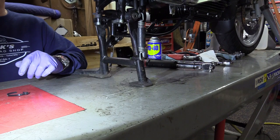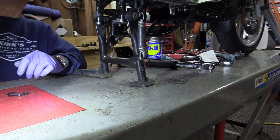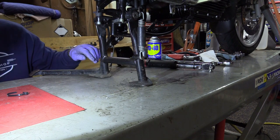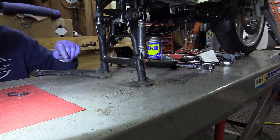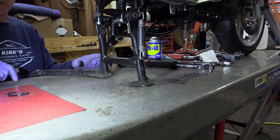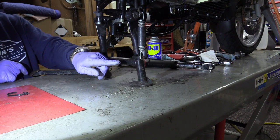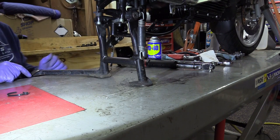I'm going to reposition the camera so you can take a look at the center stand. I'm going to continue to go up with my jack and just kind of follow along with my jack stands. Right about the time that it starts to lift off, I'm going to make sure that both sides of the center stand are coming up evenly. I'm probably just going to torque this side down on the front and it will straighten that out, so I've got a nice even lift going off of my lift.